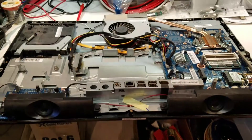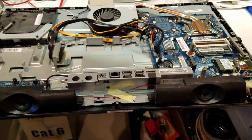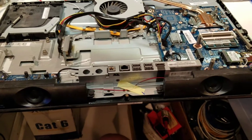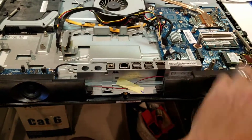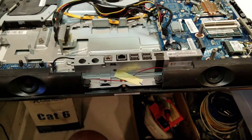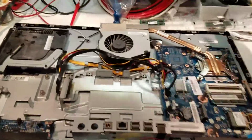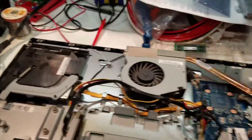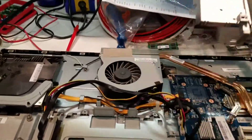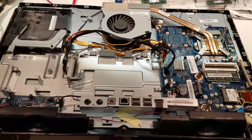Having slid the bottom shell off, there are some screws along the bottom that were covered by that shell. Remove those screws, then use a safe open pry tool along the left and right edges to pop the top cover up — it just hinges off. There's some shielding inside that you need to take off with about half a dozen M3 screws, and then you're ready to diagnose.